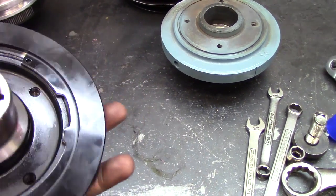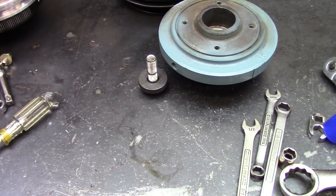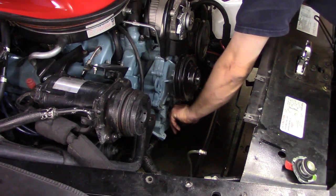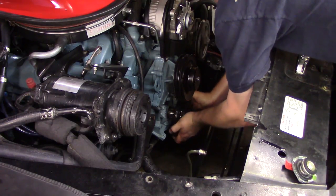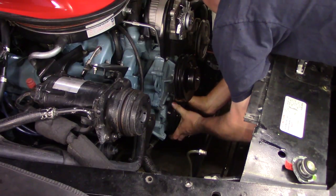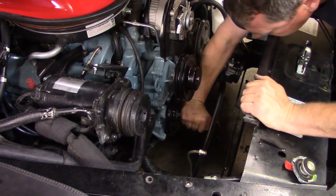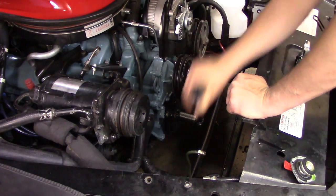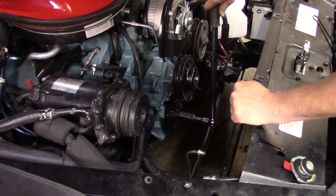I don't know if this is going to be a press fit or not. There were some comments when I was originally doing it that the Pontiac balancer is a slip fit, and then you end up with a big torque number on this bolt. We'll see if this new balancer slips on. Put a little grease on the OD of the balancer. Pretty snug fit - I think it will work just fine. I won't be the least bit surprised if this motor wants to roll over. I'm going to have to get the finished torque on this from the bottom.